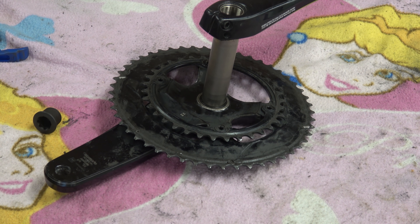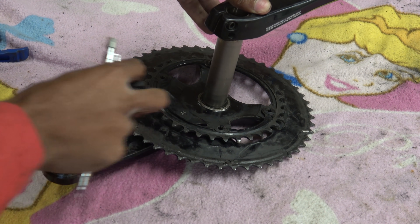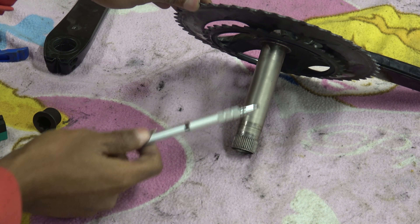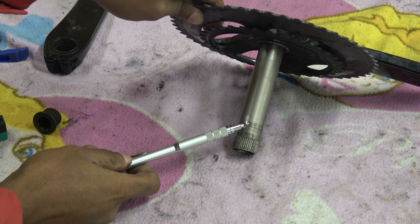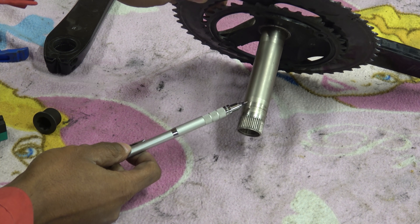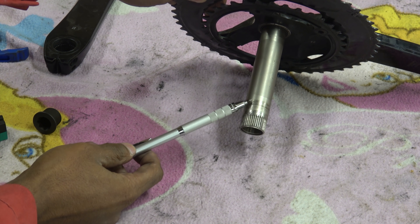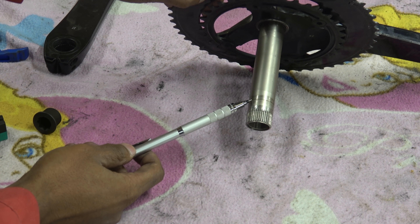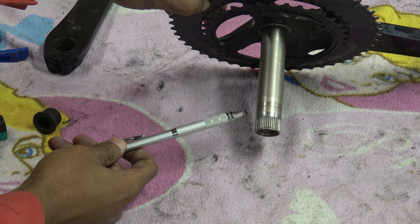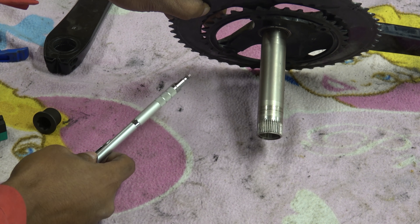This part is steel — a steel axle. It's magnetic. The rest is basically aluminium. The bit where the axle goes into the bike is 24 millimetres, which is unusual because standard bearing sizes go up in five millimetre increments: 20, 25, and 30 is popular. Shimano have done it so the axle never touches raw metal, to prevent under-rotation and axle-induced wear. It's a good design but it makes it more difficult for aftermarket suppliers, who need non-standard bearings or Delrin sleeves.